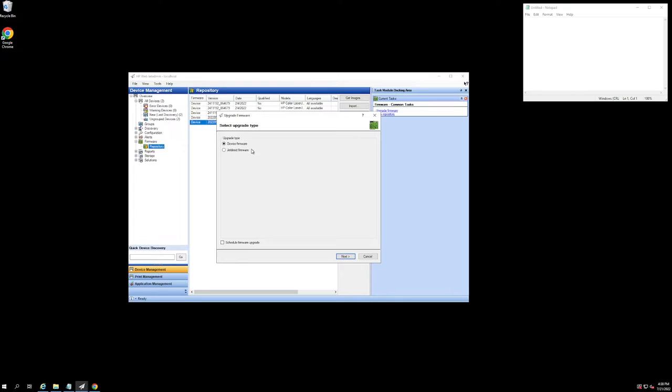we're going to be upgrading device firmware. JetDirect's pretty old technology, but it's available to Web Jetadmin if for whatever reason you have a JetDirect device. And something that I highly recommend you do is check this box for scheduling your firmware upgrade, because while Web Jetadmin is going to be executing any type of update, that printer is not going to be available for any kind of printing activities, as well as if for whatever reason someone accesses that device during a firmware update, it will likely break the device and we would have to send out a tech to come fix it.